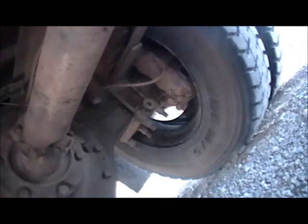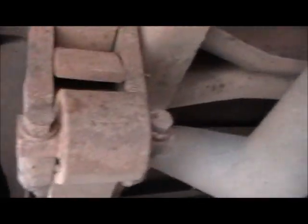Now I have regular hydraulic brakes. I don't have air brakes. Air brakes are more maintenance, and I've heard different things. One, they said you have to have a CDL to drive them with air brakes, but I don't think that's necessary if it's a private vehicle. But at the same time, there is more maintenance, and you have to worry about them freezing and this kind of stuff. So that's why I don't feel too bad about not having air brakes. But you check all this stuff.